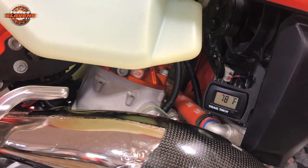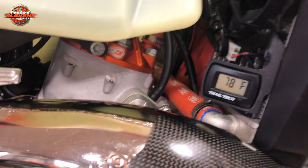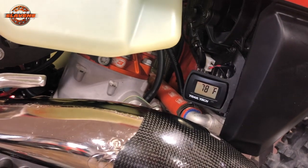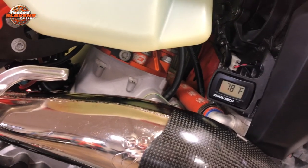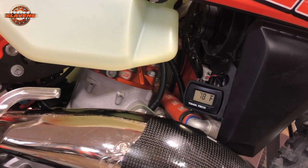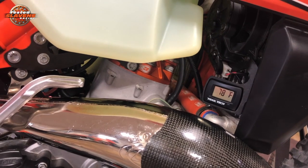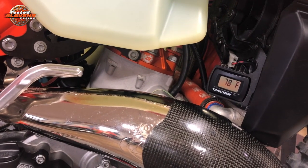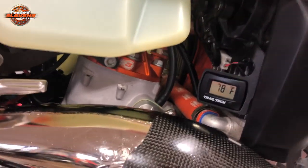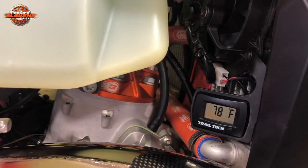And then you can adjust the temperature. I run mine where it kicks in at 188. You can see in there the orange hoses. Those are from Samco. And I put those on there for reliability issues. I really don't care about the color or anything else, but the stock hoses, I've seen them split. They're very, very flimsy, and these Samco hoses are by far the best on the market. There's not even a close second place out there. They're an excellent product, made in Europe.